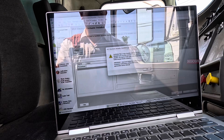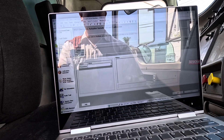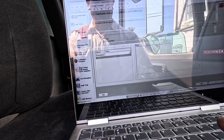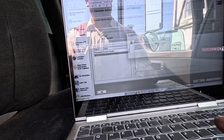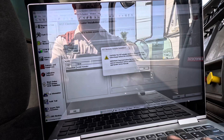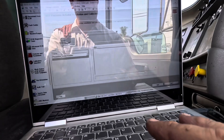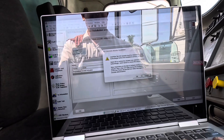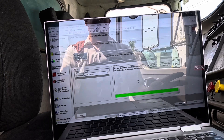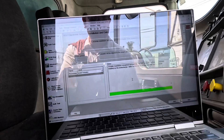This is not a functional test of the actuator — attempting to do this, you gotta read that. Click on okay. You wanna go to where it says procedure. In your procedure, you're gonna click on install actuator. It tells you the actuator must be removed from the turbocharger before the process can begin. Click on okay. Click on start at the bottom right — it's gonna warn you again, click okay. The VGT is gonna do its magic. At this point, the VGT can now be physically installed to the turbocharger.